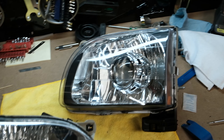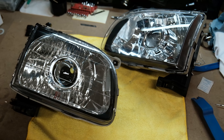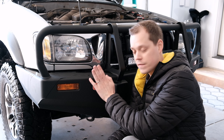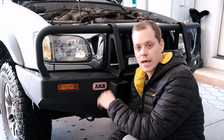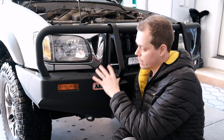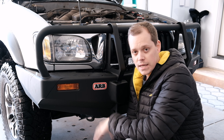We just finished both the headlights. This one just came out of the oven, so we just clamped it together, and now we're going to let it cool down. Then the fun part comes — installing them into the truck. Lucky me, I'm going to have to actually remove my front bumper to get my grill out so I can get the headlights out. You won't have to do that if you have the stock bumper or one that doesn't have any hoops. But if you have an aftermarket bumper like the ARB one that has hoops preventing the grill from coming out, you will have to take the bumper off.